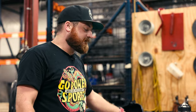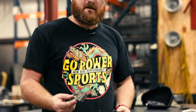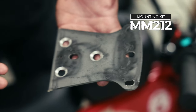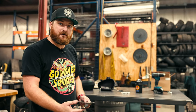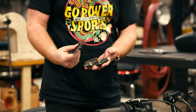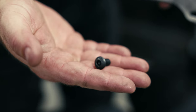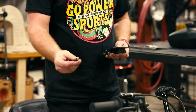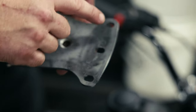The Mega Moto 212 kit also fits Coleman bikes with similar frame styles like this RB200. We're now selling the second generation, which has rivnuts in the bottom piece and countersinks in the top piece. You mount these by placing the bottom piece in just like the MM80, then the top, and take the flat head screws through the countersunk top into the rivnut. When you're ready to install the tank, this kit also comes with button head screws with a 3/16-inch Allen head that attach the tank at the designated locations.